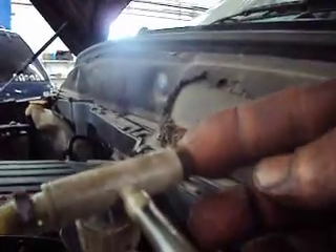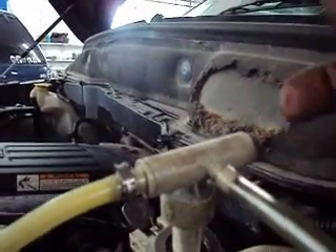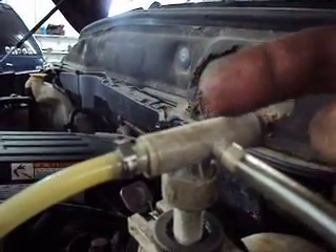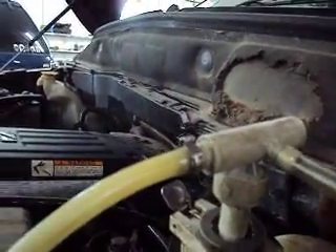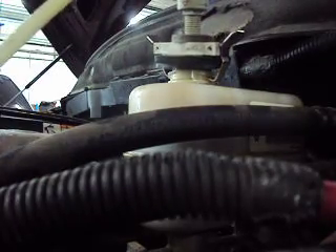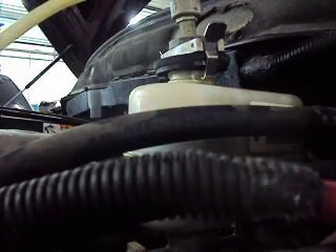You've got a little thumb screw back here that you turn one way to tighten and the other way to loosen. When you push it in, you're pumping up the bladder; when you pop it back out the other way, then you're building pressure in the reservoir. So the first thing we'll do is make sure that's tight, push her in, and pump her up.